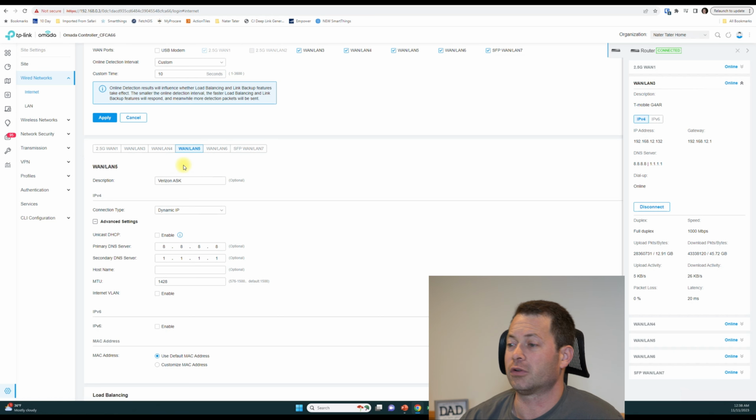So you can have it if any WAN fails or if all the primary WANs fail. So you can have like 4 of these WANs all together, and then say, okay, if all 4 of those fail, then yes, go to this last one, but only as a last resort. So those are some types of things that you can change in here.